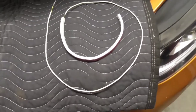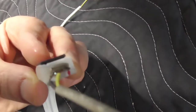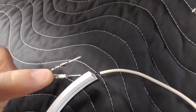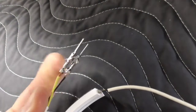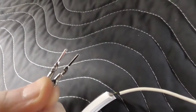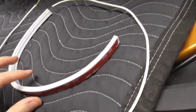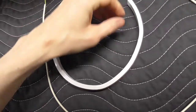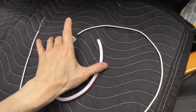Here's what it looks like after it's fully assembled and ready for installation. We went ahead and soldered our wire in. These are kind of like pressure connections, but I went ahead and soldered them as well — I never trust the type you just press on; the only way to be really certain is to solder it. I've also applied the double-sided tape. Make sure when you do this that the strip is already in a U-shape; otherwise you'll get lifting — the tape will start to curl up and come off.